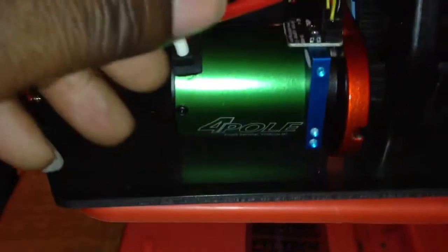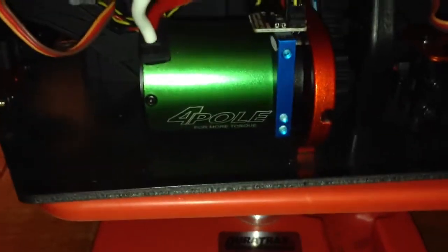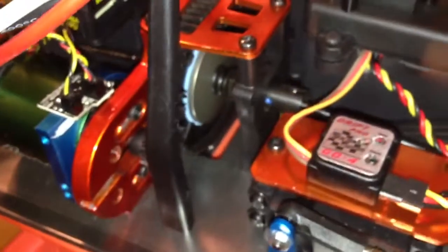I put the capacitor in there just in case. One thing I am waiting for is another fan and heat sink to put on this motor — I hear these motors get pretty hot. I ordered it anyway. I'm going to take that bracket off — it's made by Yeah Racing — put the heat sink and fan on there, and then attach the original Airtronics sensors that come with the kit.